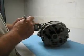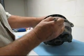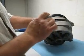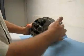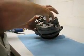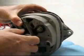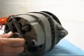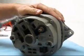The first thing you want to do is mark the alternator, maybe with a dot. I put a couple dots on here — a dot here and a dot here — so you can tell the orientation of the rear housing to the front housing. This housing has four different holes in it, so the rear housing can be rotated in four different positions, so we want to make sure it goes back together in the exact correct position. The first step is to remove the four through bolts.